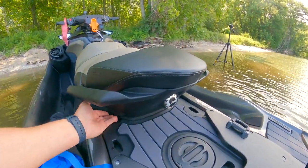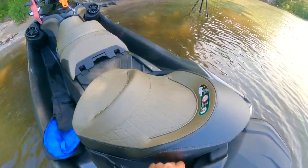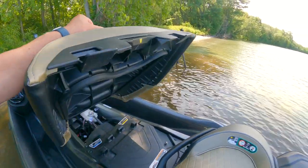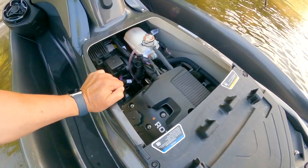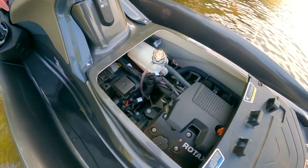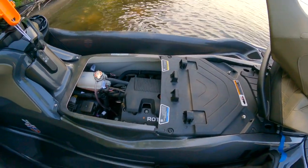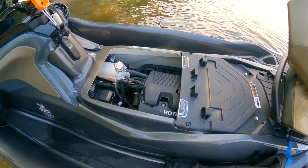The seats are really easy to remove — just a couple of little buttons to click and the seat pops right off. If you come up to the front seat, one button there and you can remove that seat as well. With both seats off, you have access to the engine compartment — you can check the coolant levels, the fuse box is in here, and the dipstick and oil filler are right there. To do an oil change, you'll need to take the rear deck off by removing all those screws, because that's how you access the oil filter. The oil has to be sucked out through the dipstick with a suction pump since you can't drain it the conventional way.